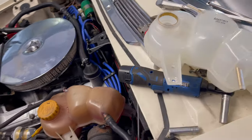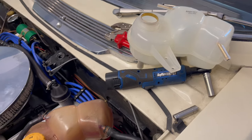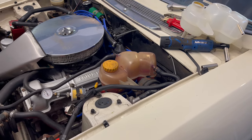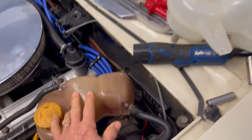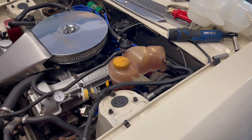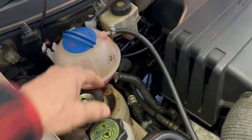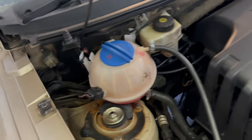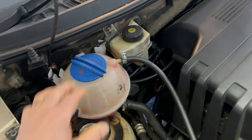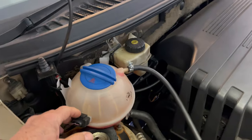If you want a nice convenient water tank, that's a good one to buy — very cheap and fairly easy to fix. This applies to quite a lot of different classic cars or even modern cars if they're not designed correctly. Also have a look around on eBay because you can get expansion bottles that have a level sensor in them. The best one I've used a couple of times is from the VW Tiguan and a few other VWs — quite easy to mount by clipping onto various pipes, or you can cable tie it to various parts of your engine.